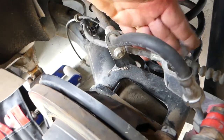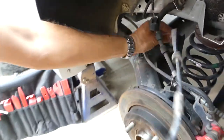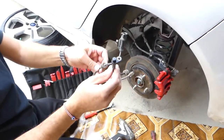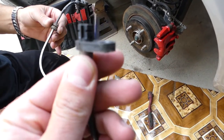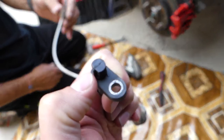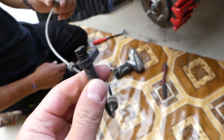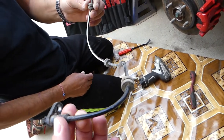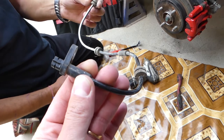The bolt is almost loose — perfect. Now grab the sensor and pull it straight out — don't twist it. This is the speed sensor. You can see the profile of the sensor shape, which is why it doesn't let you twist it. Just put it back together in reverse order. Thank you guys for watching, please subscribe, and many more videos to come.